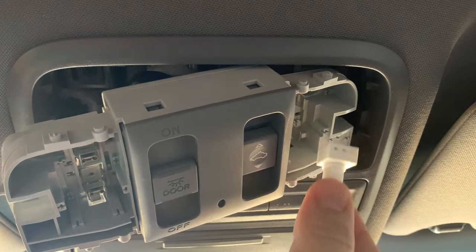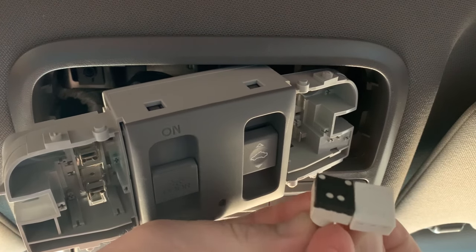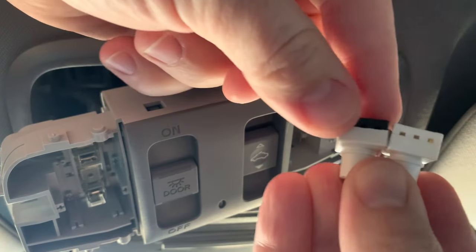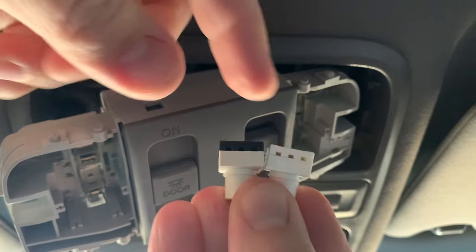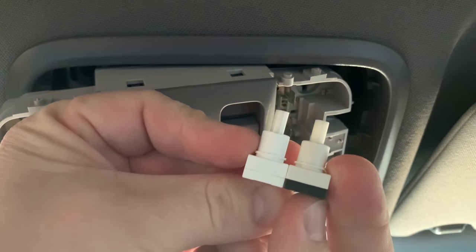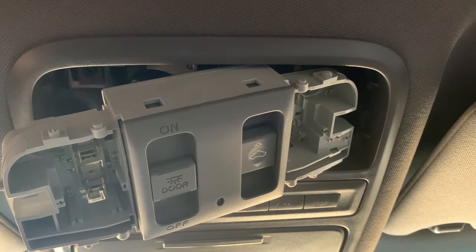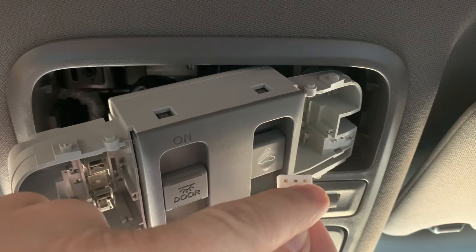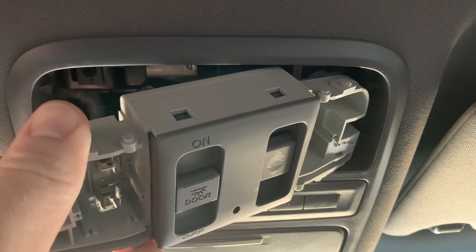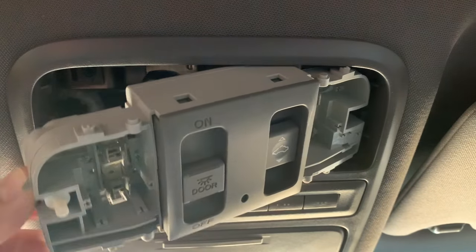I went on Amazon.com and was able to purchase some new switches that say they will fit. They do look a little bit different — they're not black on the bottoms like the OEM. But the holes are in the same place, there are three holes right here in the same location as the white one. The profile looks the same on the bottom and the base is the same thickness, so they feel very similar with their click. These should just slide right back in where the old ones came out, and the three holes need to line up with the three copper wires coming off the back side. I'm going to slowly slide it in and I feel it snap into place.